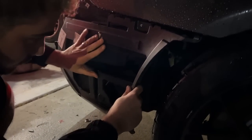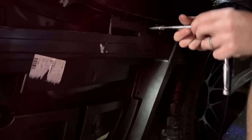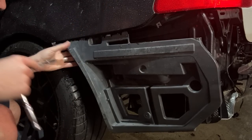Let's get the muffler on our E91 M3. But before actually getting the muffler on the car, I needed to make sure that the brackets are sitting on there and the bumper, so we're able to test fit it once it reaches the muffler shop. Without test fitting the bumper, we won't know exactly where to line up the muffler. And if we weld that up improperly, it's just going to be a mess because we're going to have to go back and get that re-welded.